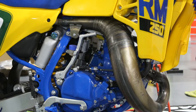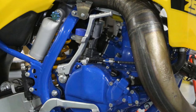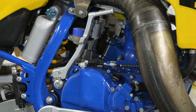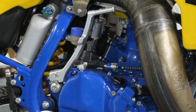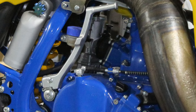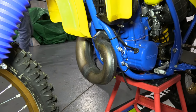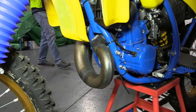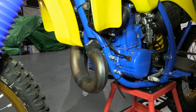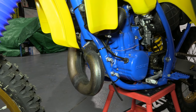One other thing about these slingshot carburettors was that in 1988, Mikuni gave this carburettor an idle circuit, which wasn't available on the earlier 1987 bike. And once more, the 250 Suzuki motor had a sort of T-shaped AETC power valve — Automatic Exhaust Timing Control — which basically was just a valve that opened and closed according to the RPM of the engine. It was quite similar to Yamaha's YPVS system that they used on their bikes in that year.